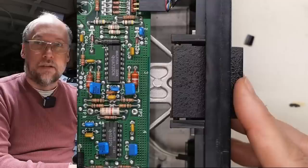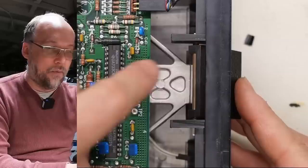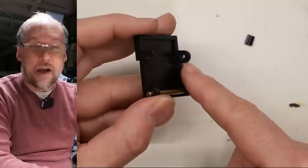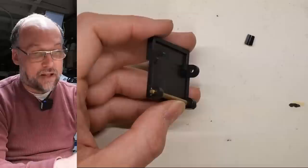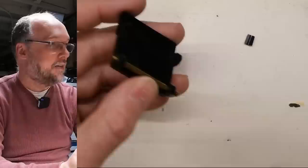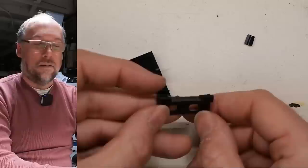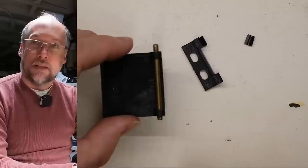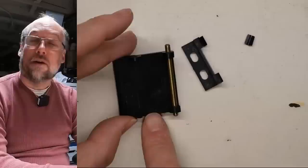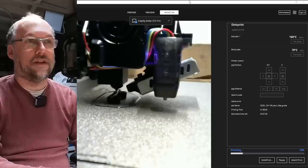The brass rod actually goes through the top part of the door here, and that rides along a little track. There's the brass rod right there — it rides inside this track here, and as you open and close it, this pivots. So the front door has two pivot points in it: the brass rod that runs along this track along the front faceplate of the drive, and the second one which is attached to the disc clamp itself. Now looking at this, I didn't even notice this but it's actually broken right here too. The little nylon pegs — I might have actually taken them out to be honest. When it first broke I looked inside the drive with the computer fully assembled, shone a flashlight up in there, and I think I reached in with needle nose pliers and pulled those nylon pieces out. But I already knew those nylon pieces aren't useful, because once this pivot point breaks you've got to replace it with the brass rod anyways. So I'm really glad that someone has designed a new replacement front door for this drive, and I'm actually printing one as we speak, because I didn't realize I was going to need to replace that along with this pivot point here.